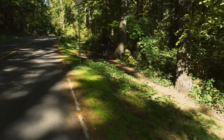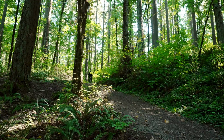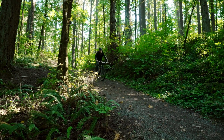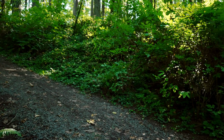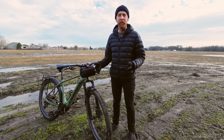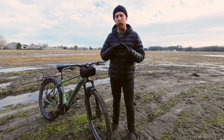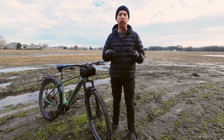As we work our way to the edge of the tire and away from the center, that's where an SUV tire starts to look more like a mountain bike tire. The lugs start to get a little bit more separated, they get a little bit taller, and those are going to offer more traction and control when it comes to riding off-road. As an SUV bike, you're hoping to spend some time off-road in mud and dirt and rocky roads. So having those lugs separated and on the outer side is going to give you more control when you're leaning the bike over and cornering.